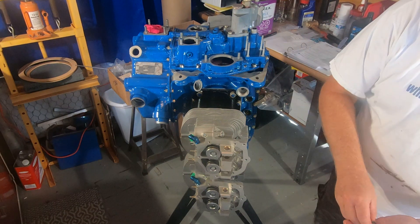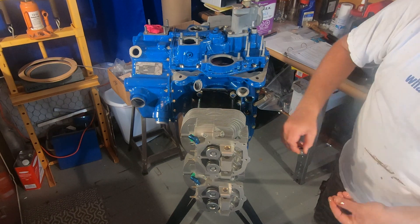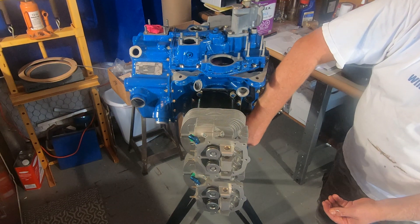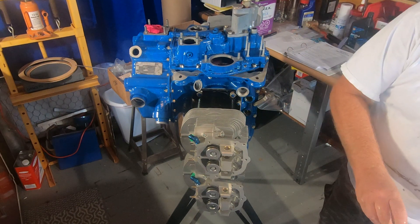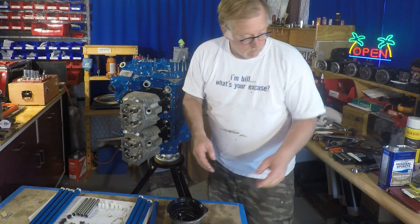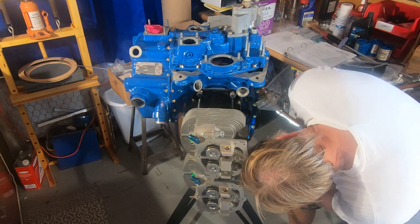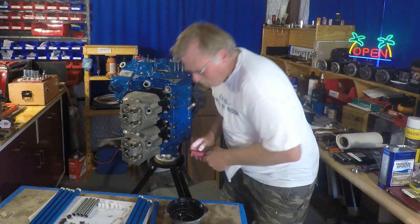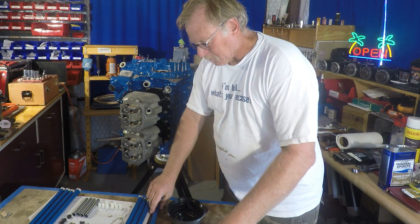What I'm doing now is putting the actual cup in. It's flat on one side and then there's a concave cup to receive the pushrod. I'm installing those cups — they just sit on top of the actual hydraulic unit itself. I've got a light and I'm double checking to make sure all of the pushrod cups are in the proper position with the concave section aiming out toward the cylinder.